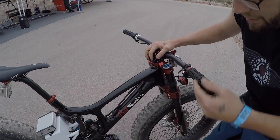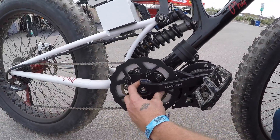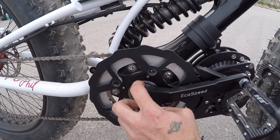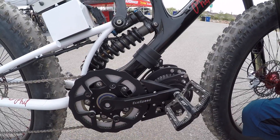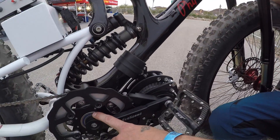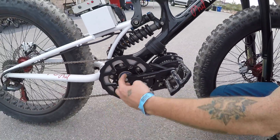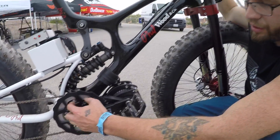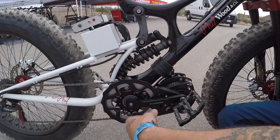We've got our freewheeling crankset in the center. That is a White Industries freewheels — a trials riding freewheel, the strongest freewheel there is, and that's also made in America. Normally that would be on the rear wheel — it allows the wheel to spin without forcing the pedals around. What we did was build it into the middle of the crankset so the motor can drive it without forcing the pedals around. So whenever you hit the power, it doesn't make you Flintstone. When you're pedaling you can pedal like a normal bike, and you use them both together — it's symbiotic.